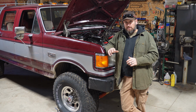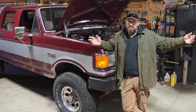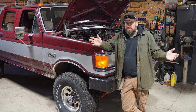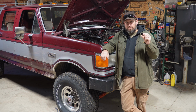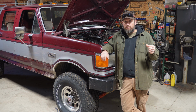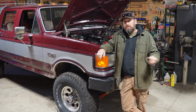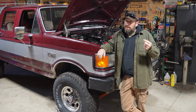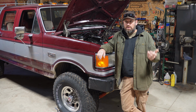The first time I even cut the oil filter wide open. I laid out all the pleating, and I didn't see anything really crazy. So if I had lost a 1/4 inch of metal off that camshaft lobe, you'd think it would look a lot worse than that. I don't know. It wasn't ticking like this when I drove it home from the auction. Then all of a sudden, after the water pump, it started ticking, and that's when I found the push rod.